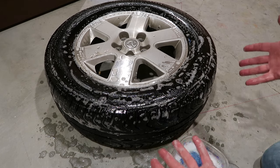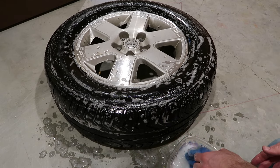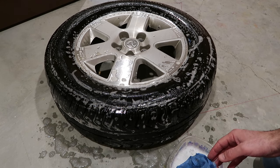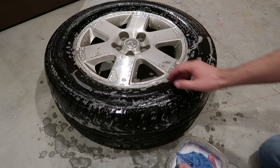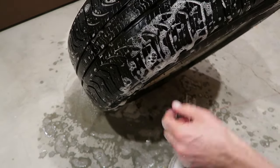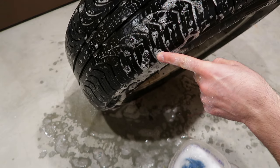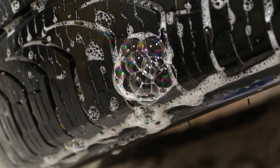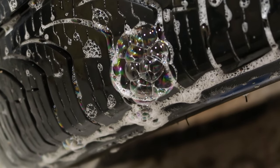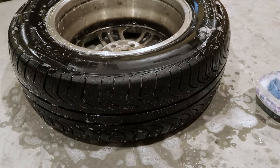I'm soaping it up and looking for growing bubbles. By the way, when you're trying to locate air bubbles coming out of your tire, you need to have air in the tire, so pump it up. Now it becomes quite obvious where the hole is — check this out, you can see all the air escaping the tire and making all those bubbles. I'm going to double-check to make sure there's not two.